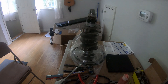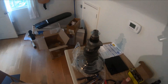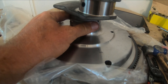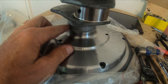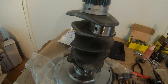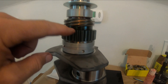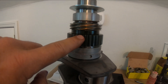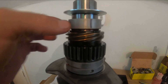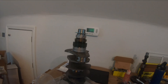I got the parts on the crankshaft. The crank is sitting on top of the flywheel with the thrust bearing pointing down toward the flywheel. I've cleaned all of this and cleaned out all the oil passages. I have my straight-cut cam gear, spacer, distributor drive gear, clip, top bearing, oil slinger, and woodruff key all installed.